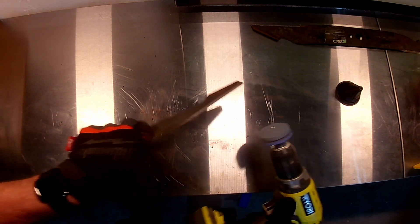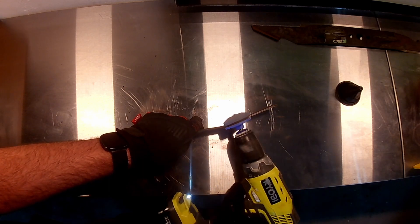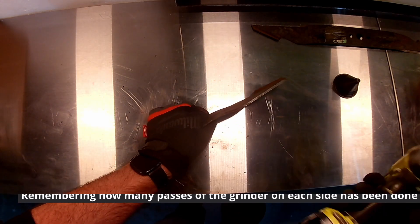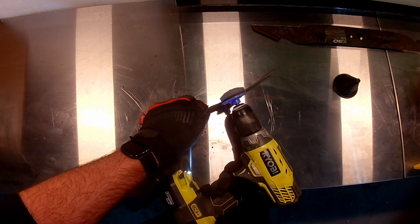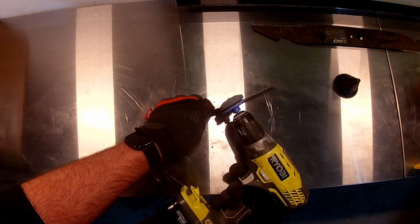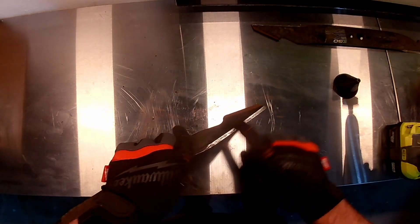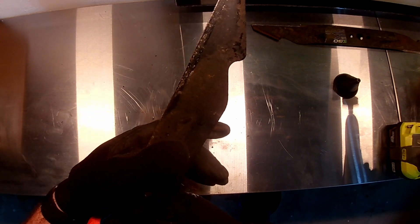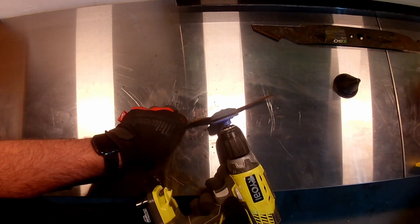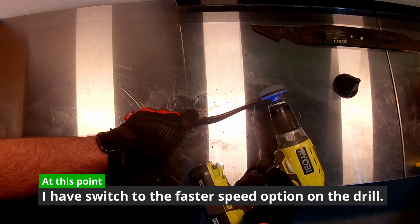When sharpening, you do want to try to keep track of how much you're taking off at any given point. You want to go in one action, out away from the center of the blade. Make sure you've cleaned up the blade as much as possible — no rust spots, anything like that. Of course you've got to take material off to do that. Also, this blade has been through a season and will have stuff caked on it that might affect your balancing, so you may want to clean it off first.